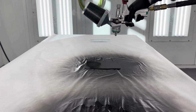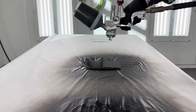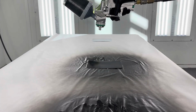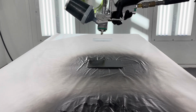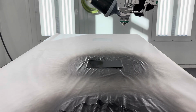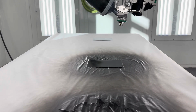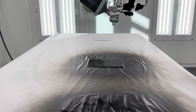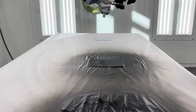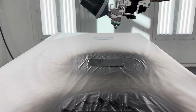In this part, we can see the painter completed painting the spray out card and then decided to use the paint gun to help to dehydrate the paint. The problem with this method is the spray pattern is very narrow, which is not very effective at drying the paint. And when you are using the trigger and the triggering method, if you're not careful, you will have base coat come out of the gun, which we've seen happen a few times here. That can ruin your paint job.